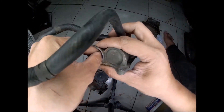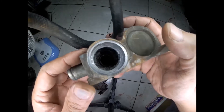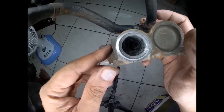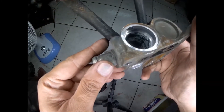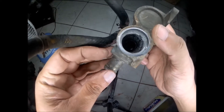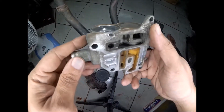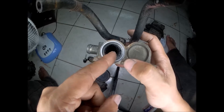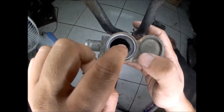Look at the inside — it is already corroded. Here is the counter spring. You can see the inside of the idle valve. There are many white spots inside and it is still very dirty even after cleaning with a normal process of spraying car cleaner or throttle body cleaner. There is also damage to the valve seat. On this type of idle valves, the valve seat is made of rubber. If the inside is corroded, the rubber seat will detach from the aluminum part of the idle valve.